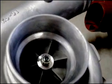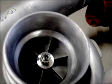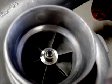I have also ported and polished the compressor side about 3mm inner diameter. I have also ported and polished the compressor discharge, probably about 3.5mm, and tapered it to the outside of the discharge nozzle.